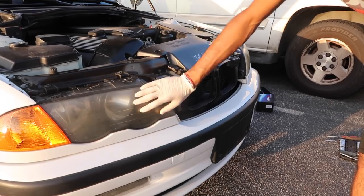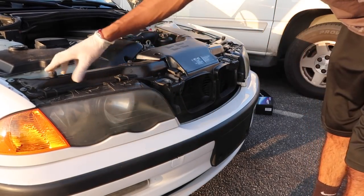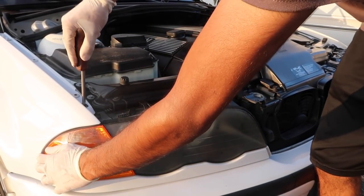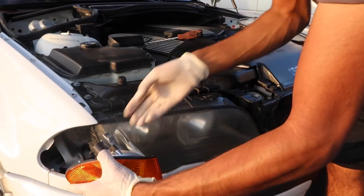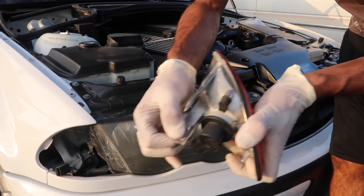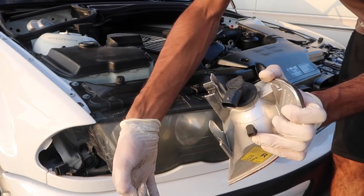Let's get started — we're going to start out by removing these headlights. As you can see, the headlight lenses are also very foggy. First, you want to remove the corner light and the trim, then undo all the bolts and slide it out. To remove the corner light, get a long flathead, there's a hole right here — stick it in there, push that tab down, and it will just pop right out. Once it pops out, undo the connector for the bulb — press down on this section right here, it'll slide out, then push the clip and pull off the connector.